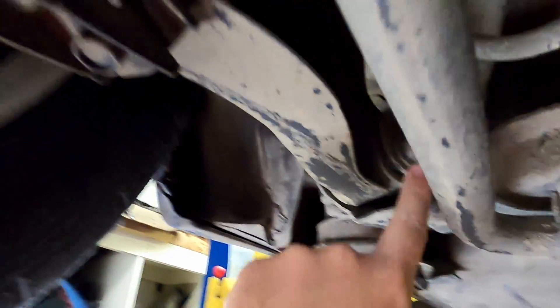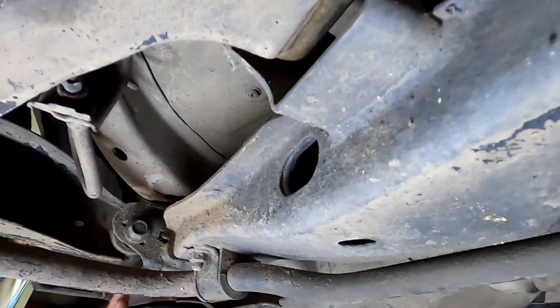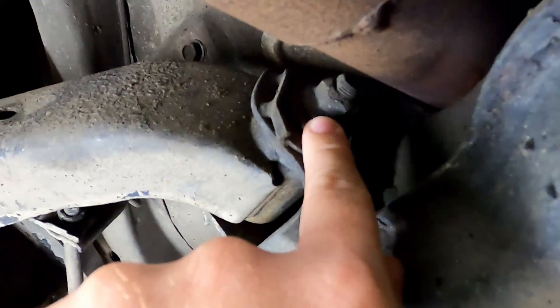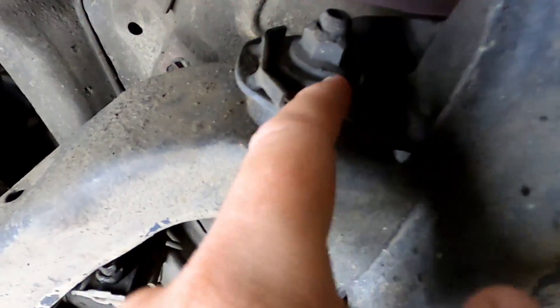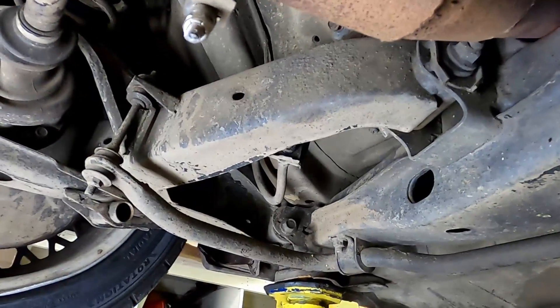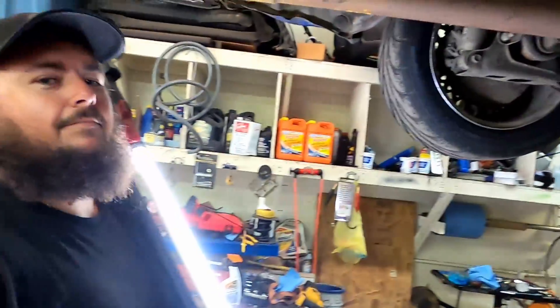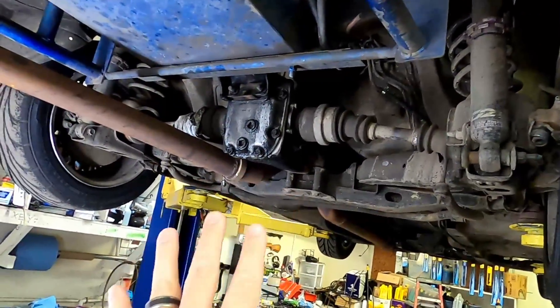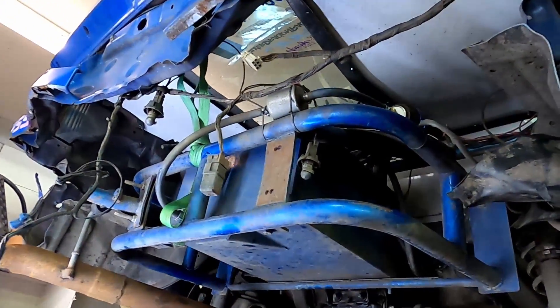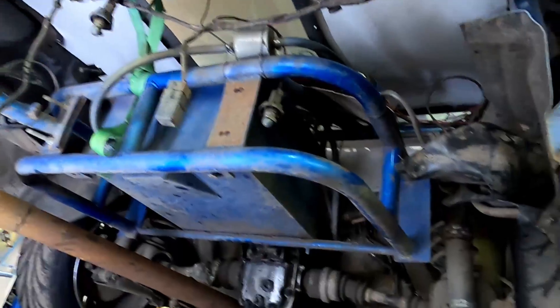You can slot this one out, and this one has some adjustment — it's got a little lobe on it and some little guides. So it has some adjustment, just not a whole lot to get it dialed in. And when you lower the car, it really causes some weird suspension geometry. He has two other S12s: one that's going to be a street car, and one that's going to be the next drift car. We're going to put an S13 subframe in it so we don't have to deal with any of this and can get readily available parts. There's the fuel cell and the tube work he's got in this. I'm also trying to talk him into building more so this stuff doesn't smash in so much.